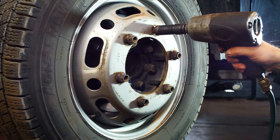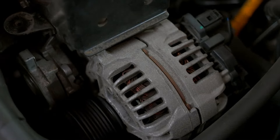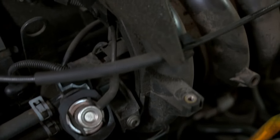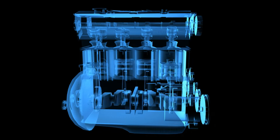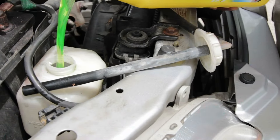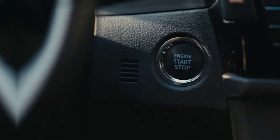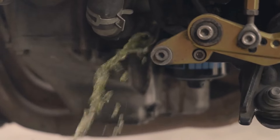Filling and final touches. With all the bleed screws tightened, it's time to fire up the engine. But before you do, crank up the heater on high. Why? Because the heater core is part of the cooling system, and this helps circulate the coolant throughout the entire system, pushing out any remaining air bubbles. With the engine running and the heater blasting, keep an eye on the coolant level in the reservoir. If it starts to drop, don't panic — just slowly add more of the coolant mixture until the level reaches the recommended mark. Let the engine run for a few minutes, keeping a watchful eye for any leaks, because a leak is the opposite of cool — literally.